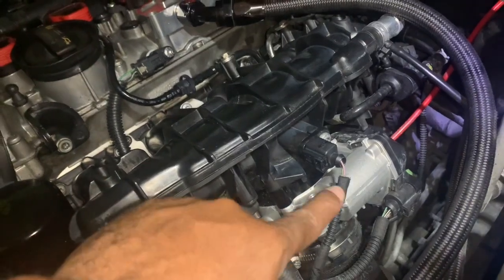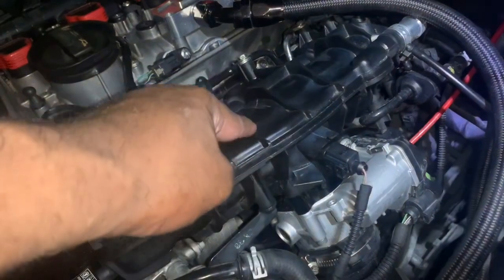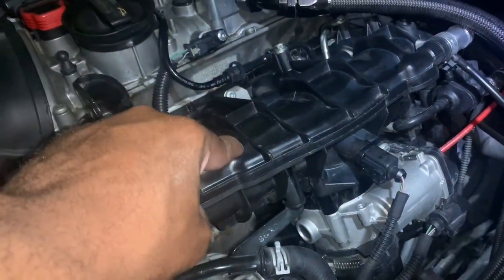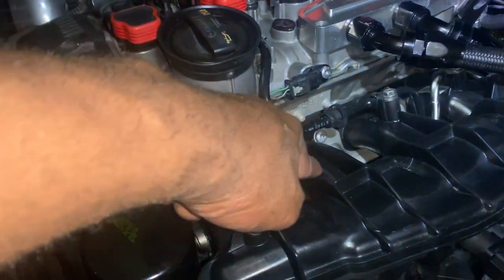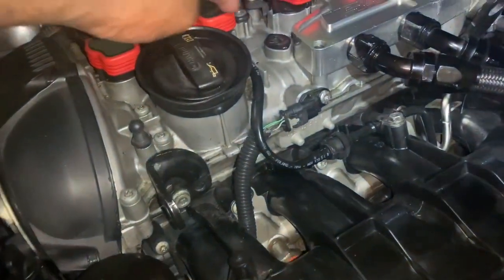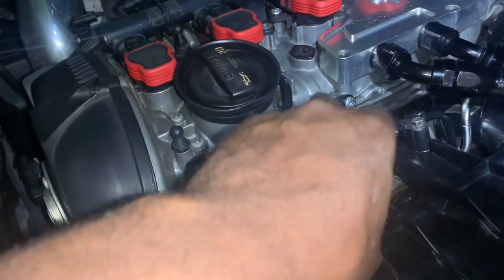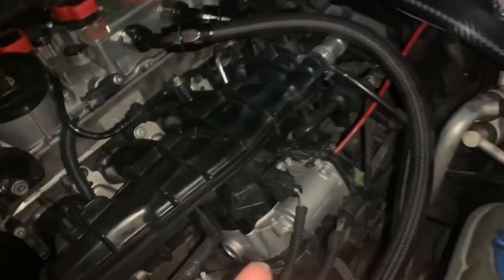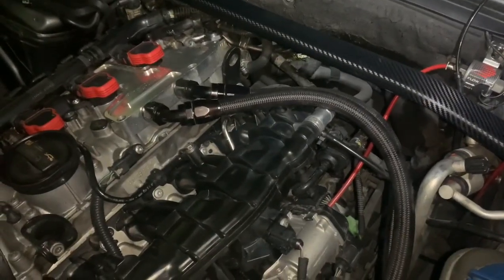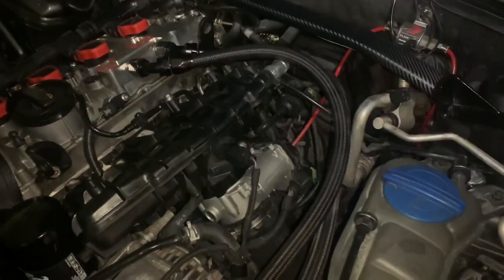and once you press the gas, which is your throttle body, all that air shoots the mist into your intake manifold. Once it goes into your intake manifold, it goes into the combustion chamber, which is where the spark plugs are. This is your coil packs. If you go down to the coil packs, you have your spark plugs, combustion chamber. They all meet up, and all of that water meth, which is about 105% octane, causes a super big combustion. And bam, that's how you get the extra power.